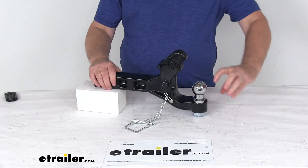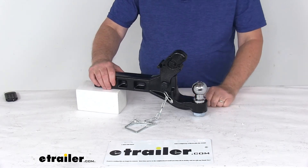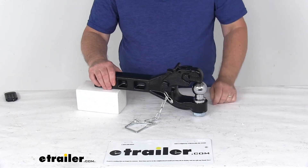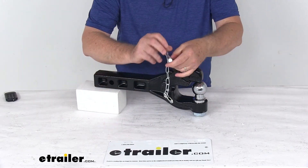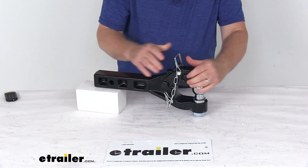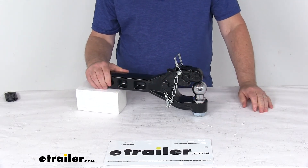Just to show you — if you're going to tow with a coupler, just drop your coupler on the hitch ball and you're ready to go. If you're going to put a lunette ring in there, all you have to do is push down on that, it'll lock into place, take your pin and clip, slide it through the hole and clip it, and then you're locked in and ready to go. Simple as that.